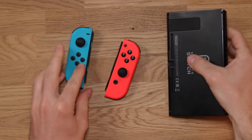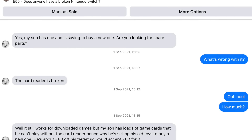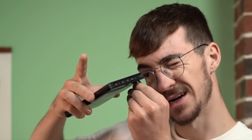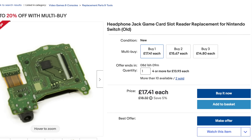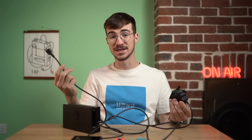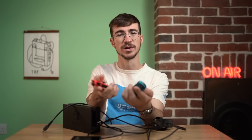Obviously it's faulty and not everybody's going to be able to repair a faulty Switch, but let me tell you about the reason I bought this one. The seller said it doesn't play games. I looked inside the cartridge slot and saw some bent pins — replacement cartridge slot boards are probably £15 to £20. It also came with the dock, the charger, and the HDMI cable, which is absolutely ridiculous. We're going to replace the cartridge connector, and I also noticed there's some Joy-Con drift on the joysticks, so we'll replace those too. It's going to be a nice little Nintendo Switch service.